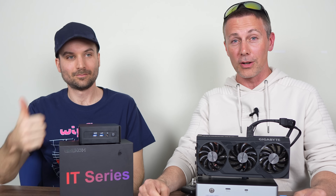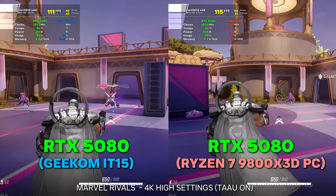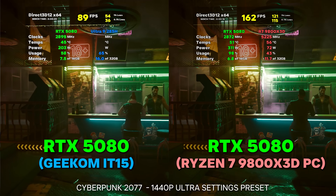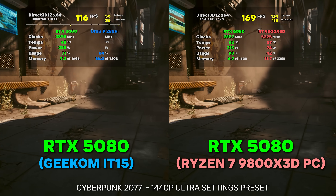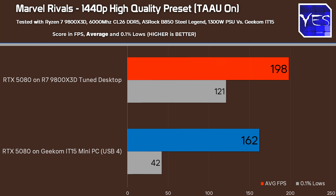We're going to see how an RTX 5080 handles with a mini PC versus a full-fledged desktop PC. We've finished benchmarking on the external GPU dock provided by Rob Tech — it worked really well with no functionality problems. Plugged in via USB4, we did see some very differing results depending on resolution and game. Starting with Marvel Rivals at 4K high settings — the best-case scenario — we really only lost about 8% average FPS. However, do pay attention to the 0.1% lows, as they were significantly lower in every resolution and every game tested.